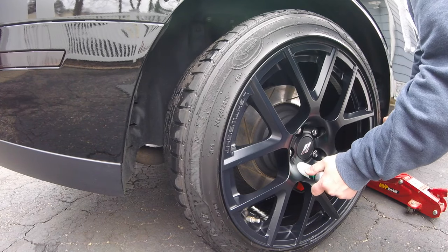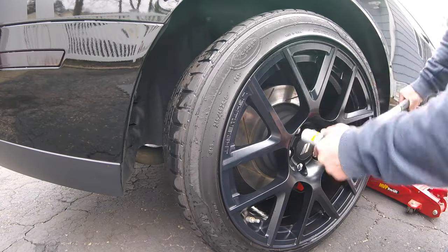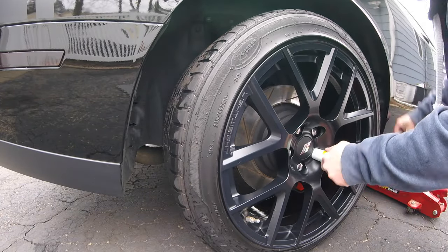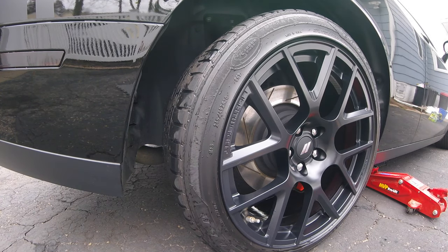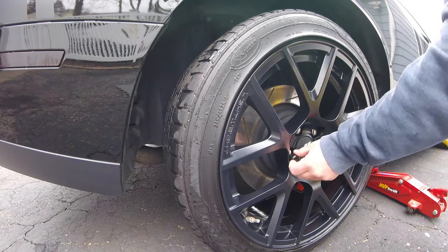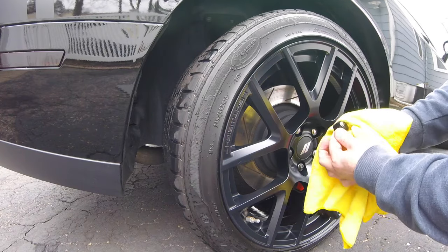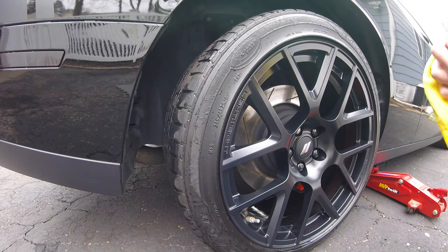The lightweight aluminum wheels with the stock lugs should be torqued at 130 foot-pounds as per the 2015 Challenger manual. Be sure to check the manual for your specific model year for the torque specifications. I've been asked a few times to do a video on getting all four wheels off the ground, but I find doing this a bit sketchy because the car starts to teeter on the jack stands when you're lifting up that third wheel, so I don't really encourage this practice. If this video helped you out in any way, feel free to gently press that like button. If you're stopping by for the first time, please subscribe, and as always, thanks for watching.